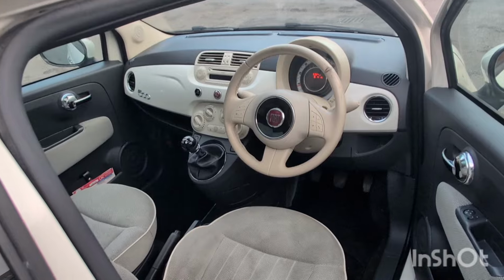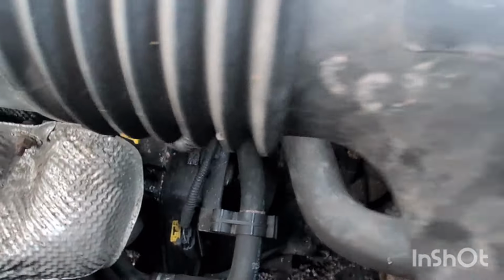The people were coming to actually pick this car up, but while they were on the way, instead of cleaning the bird muck off and making sure it was ready, I actually noticed that there was a leak. It was coolant again. So I don't think it's anything to do with the radiator that was replaced. Might have helped bring it on a little bit, but I don't think it's a linked issue or an issue caused by that. So it is just down here. You might be able to see a bit of pink under there. That is coolant crustation there, and it's around this pipe, but I think it's actually coming from the thermostat housing.